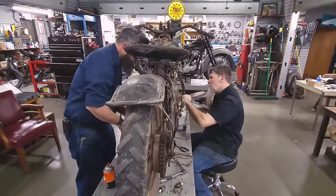Let's grab the battery charger. Oh my God — hot to the coils over here, running off this wiring harness. We've got our hot here. We're about to blow our battery charger up! Do we have spark at the plug? Oh yeah, look at that — bam! That is a hot coil. So compression: check. We put the battery charger to it, we had spark at the points and we had spark at the plug. So two out of three so far. Now we need fuel.